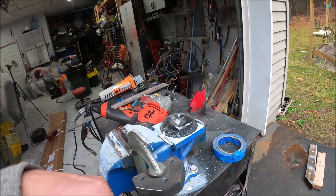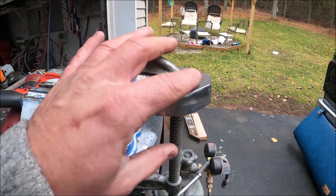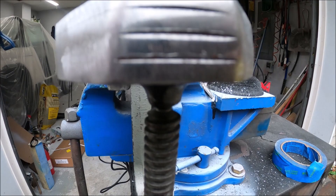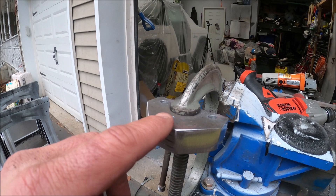What you're gonna do is make the brackets that go inside the van. The angle iron goes on the door. I like to make all my brackets at once — I cut a bunch of two-and-a-half inch pieces. You can make them as big as you want, but I like clamping everything together so they're all perfectly symmetrical. I cut it, sanded it, drilled it — these four are ready to be primed. These go inside the doors.